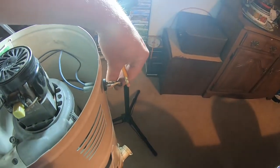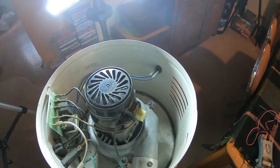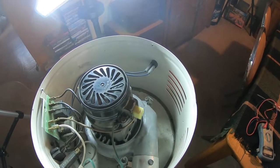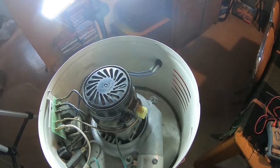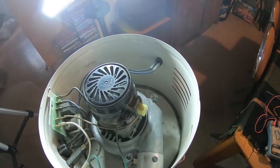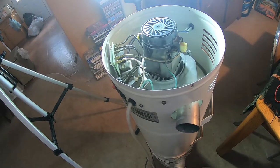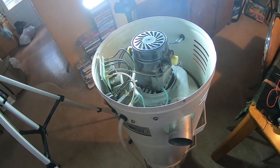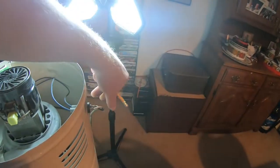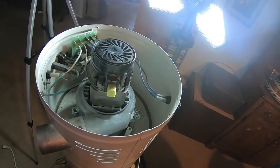The one other thing we have here is these two blue wires, which also go into the bottom of this circuit board. I believe them to be low voltage wires, and I believe this to be a transformer to lower the voltage for those two wires. Those two wires come out and go to basically what they are - a switch. I believe those low voltage wires are the ones that go up the wall and right to where the vacuum plugs in. They are the ones that turn this machine on when you plug the vacuum in, because there's a switch on the vacuum.